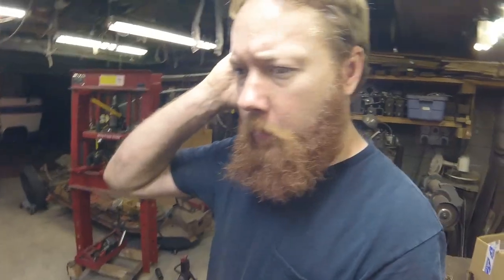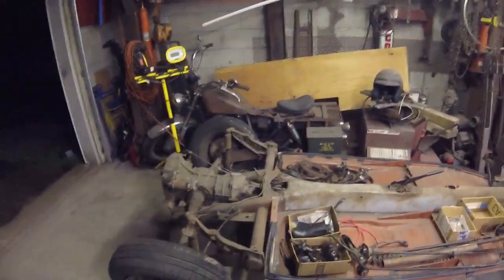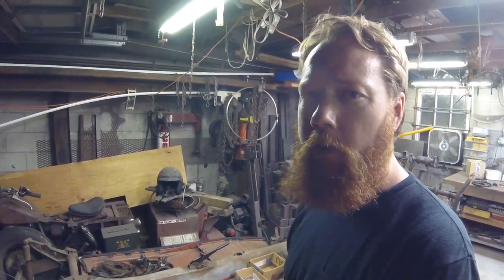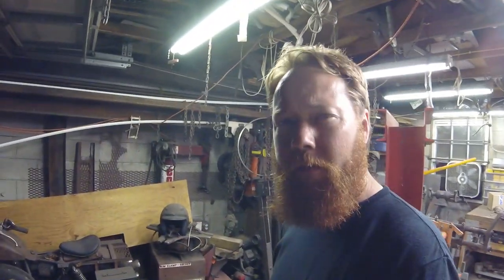There were a couple of hurdles today. Popping the ball joints out of the trailing arms — that was kind of a question mark. This time around I think I got it figured out a little bit better. The press work went pretty smoothly and quick, and there wasn't any part of it that felt like it was going to go shooting across the garage. The rule with a press is that it's 90 degrees — 89 degrees is a no-go. I've got a good collection of parts over here ready to be sandblasted tomorrow. Hopefully before the end of the day I'll be able to wash it, etch it with phosphoric acid, and then rinse it all off and get it dried so that on Monday I can have a big paint session. POR-15, at least two coats, and a dust coat of primer.